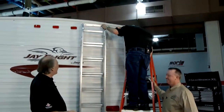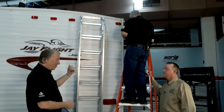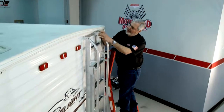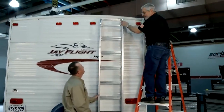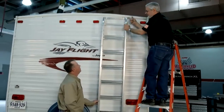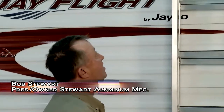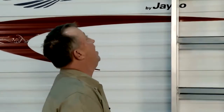All right, I'll tell you what I'm going to do. Since you're here to give him a hand, I got another project I'm working on. I'm going to leave you guys alone. Bob, I put a little bit of Loctite on these threads. Is that okay with you? Yes, sir. And you can't over tighten these. Well, you can. You should tighten them down just enough so they'll pivot, right? That's correct. We've got a cap that seats just off of being tight, because if you over tighten them, you'll break the cap, but that way it still allows the ladder to swing.